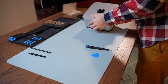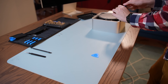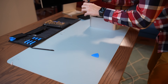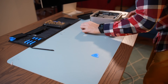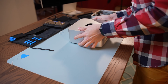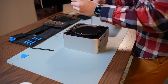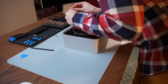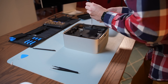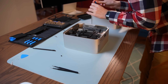Things aren't going great, but I decided to try one last experiment. Since we saw that we were not able to boot from the second SSD slot, I decided to swap the SSDs. This isn't really an upgrade so much as an exchange. I took the SSD from the $5,000 machine and put it in the $4,000 machine to see if the system would boot from a known good SSD in a slot that we know the machine is actually capable of booting from.